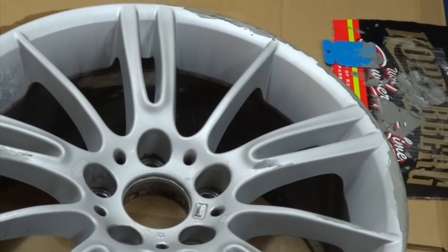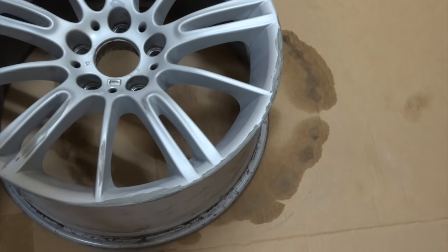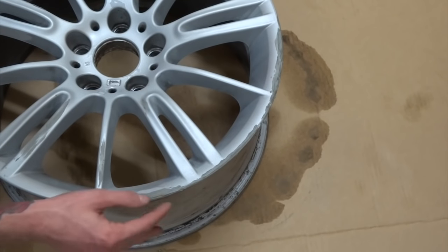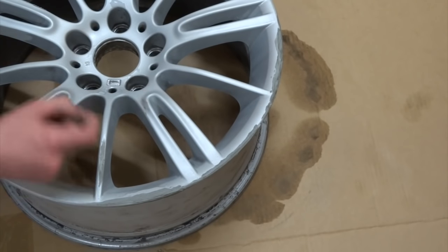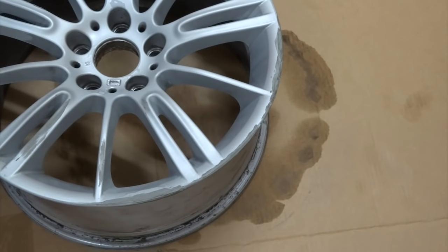I'm going to leave this another 20 minutes, start sanding it back, and we're going to see whether or not we're going to need to make a second pass of filler. If it starts gaining a weird hard consistency, that is too late — bin it and make some more. If it feels warm and if it's tacky, do not touch it. It's really important to leave this long enough. 99% of the end result is the preparation — the fact that I've cleaned it down, the fact that I've sanded it all back so that every bit of paint is as shine-free as possible and has a nice key to it. If you're at the point when you're adding primer and you haven't bothered to add that little bit of filler, and the primer doesn't fill it, you're going to have to sand it back and go at it again. So you might as well try and get it perfect every single stage.